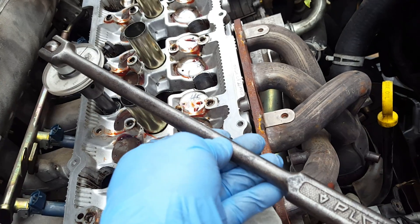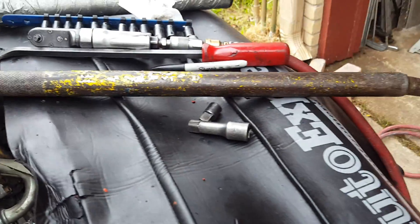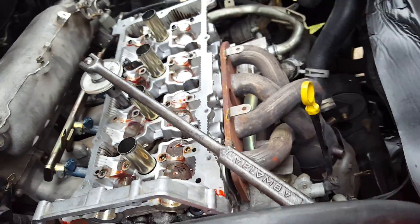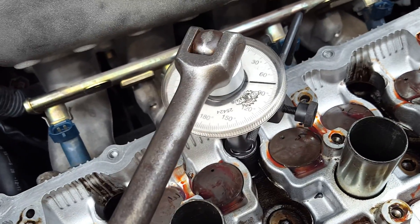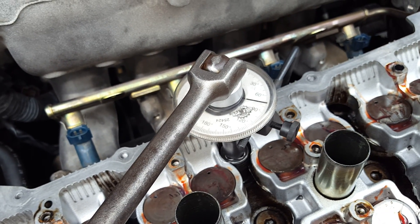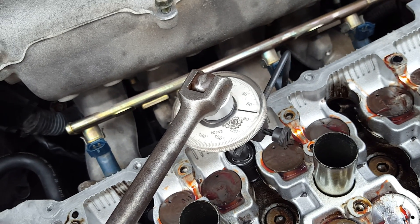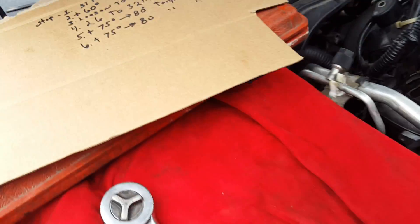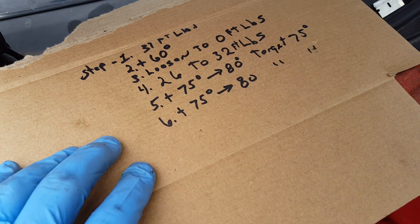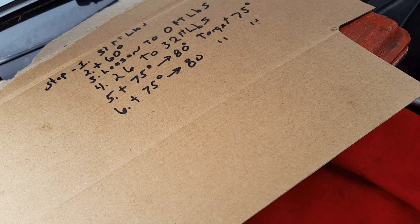That's where we're at at 75. One thing to mention: when you start, it's easy to get that pull going, but near the end it's very hard. So get a nice long pry bar and start with the pry bar so you can make one clean pull to 75. You don't want to bump it and jiggle things trying to get it to the right spot — moving it around won't give you the clear reading you want. This is not fancy high-tech digital — it's just a cheap little dial, all mechanical. We're getting it close. Obviously we're never going to get it perfect, and the manufacturer has given us a wide range anyway. We just want to get it as close as we can. One pull — use a torque angle extension, torque wrench, cheater bar setup.